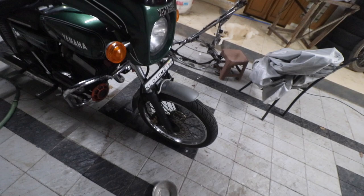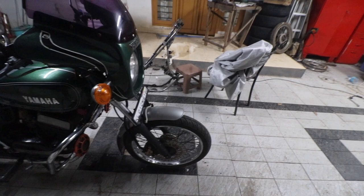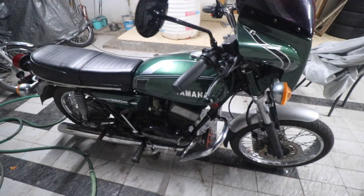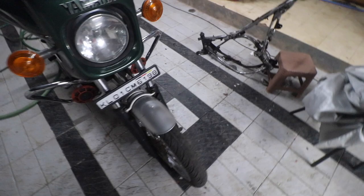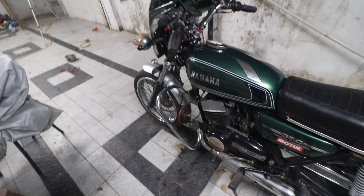Once you convert to disc brakes, you need to understand that the bite is going to be pretty intense. If you have old and rotten tires, change them immediately. What happened to me was my rear tires were rotten and wider than what I have now — when I applied the front brake, the rear lost grip and I slammed on the floor head first. Unfortunately this happened right in front of my house, so I didn't have a helmet, and that put me in the ICU for four days.